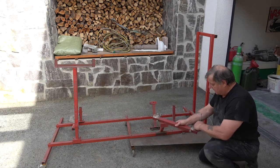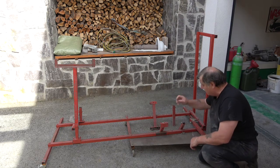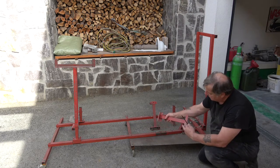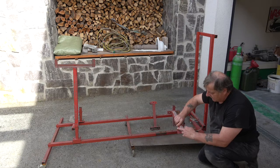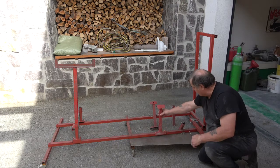These two hold the radiator on the front like that. This has been made exactly in line with the engine — these are the engine mounts, so you can see they go on there like that. Basically what they are is angle iron, all welded up solidly. Your engine mount goes on here and there's a bolt in the middle that goes down through that hole so it doesn't interrupt it.